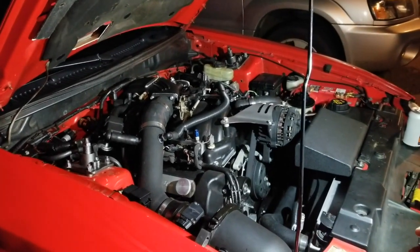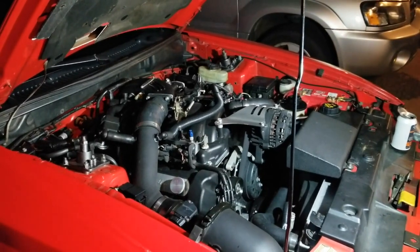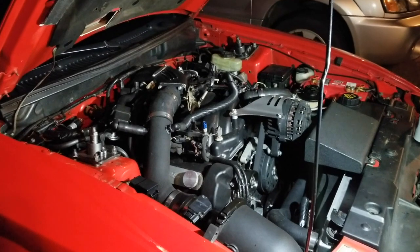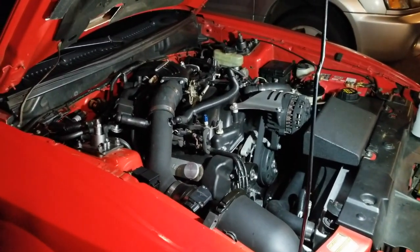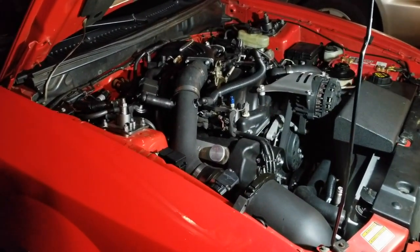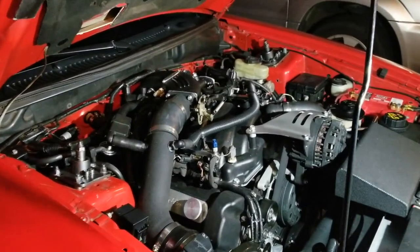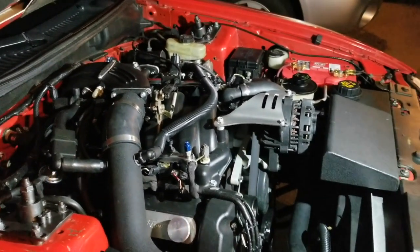The only thing I did to the block was I put a new oil pan on it, and then obviously I re-gasketed the thing from head to toe, cleaned off what little carbon was on the pistons so they were nice and shiny. It didn't have a ridge on the cylinders, so it was proof that it was a low mileage motor. It had super clean crosshatch, super visible. So it wasn't beat up, was taken care of, wasn't really spun that high or romped on.